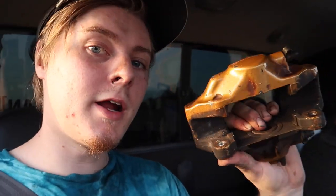New bolts, extractor kit, PB Blaster. Hopefully it'll work. If not, I'm just done - Sean, you can have my car. After hours of trying to take this apart and figure it out with the broken bolts stuck in there, it still doesn't come out. So we're on our way to Kenny's shop because he's got a drill. We're just going to drill out the hole and then re-tap it and hopefully use the bolts I already bought to fix it. I also learned that my rear coilover is seized so I'm not going to be able to adjust those.